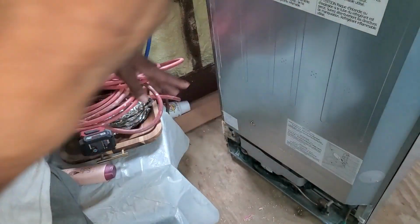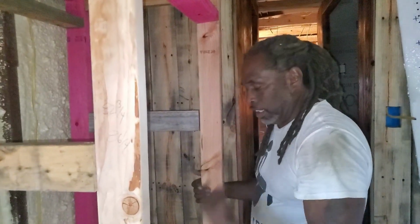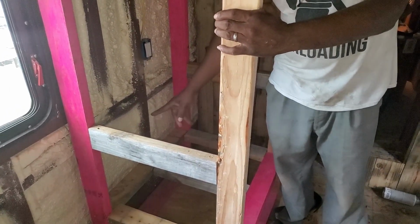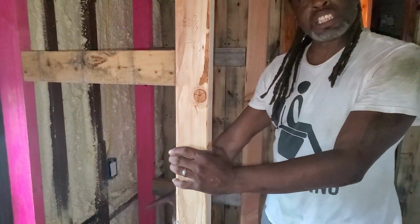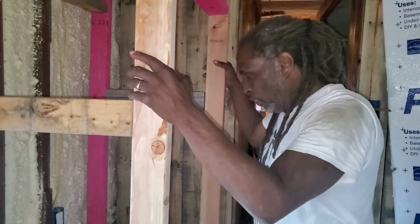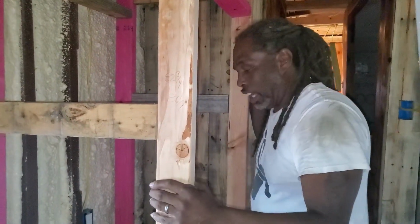As soon as I get this area right, I'll know exactly where this will be sitting. And where it'll be sitting, I have a vent that I purchased that I'm gonna cut through the metal of the bus and place my vent there so that my refrigerator will be able to dissipate heat. And also, just to please the wifey, I'm gonna put some insulation in these areas here to hold this heat in and let it all dissipate to the outside of the bus instead of escaping into the living room. It wouldn't be that much heat with the vent, but just to satisfy her, I'm gonna do that. So, with that said, I'm going back to work.